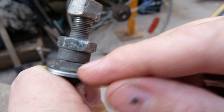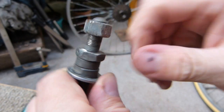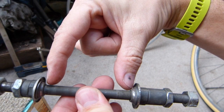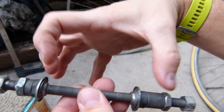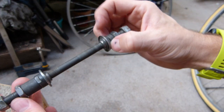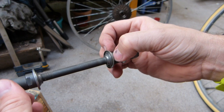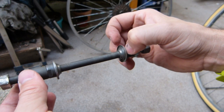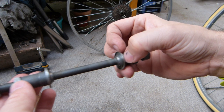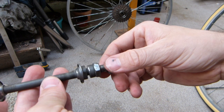A 15mm wrench needs to be placed on the cone, and the lock nut tightened against it. But the distance between cone and cone is critical — it has to be just right so it's not wobbly, and if they are too close together it's going to be binding as well. So before the lock nut is tightened, these cones on the cassette side are locked together already, and this loose cone distance needs to be dialed in by feel — checking how much play it has side to side. It has to have zero detectable play side to side.